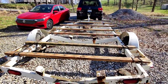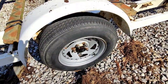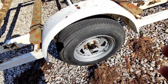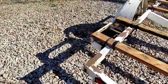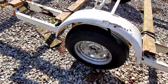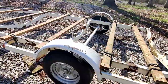The only thing I'm worried about is the wheel bearing over here — it doesn't have a cap on it. I'm going to have to get a bearing buddy so I can pump some fresh grease in. I'll probably end up having to repack those bearings or get new bearings before I start using this thing a whole lot. This one here is nice and took a bunch of red-and-tacky grease — it took about 12 pumps — so I think it was okay, but that's the only issue right now.